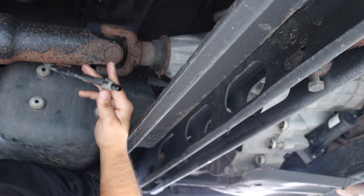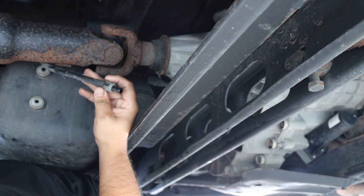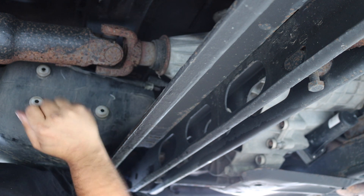This line was super easy to get off — all you do is just press this tab in and it pops right out. So one down, who knows how many more to go. The hose going to the fuel tank from the filler neck looks so old and busted, so I'm definitely replacing that. The clamps — the Phillips head to remove the clamps — are super rusted, so I'm going to drop the entire filler neck with the gas tank and replace all of that filler neck. Let's go up to the fuel filler neck and remove from that side.